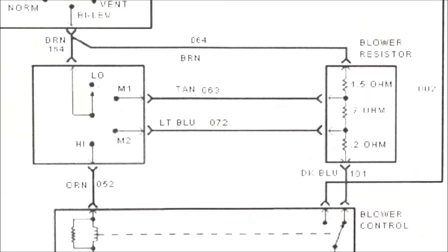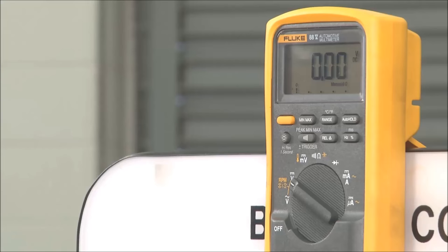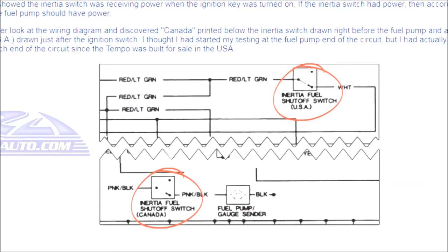The last one is the light blue wire down there — it's only going through one of the resistor blocks, so there's 10 volts. When we bypass it totally, there's 12 volts on high. It's just a systematic diagnostic approach — simple, step by step, work your way up, go slow, pull that schematic. RockAuto's got service manuals with all the schematics in them.